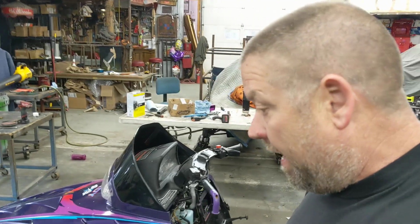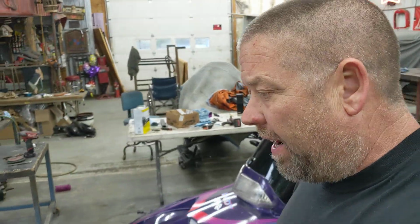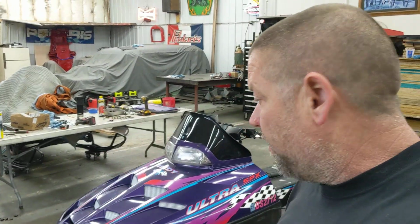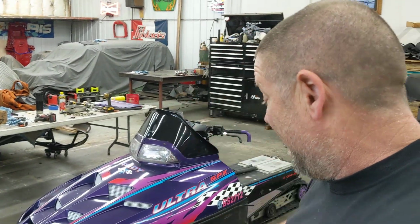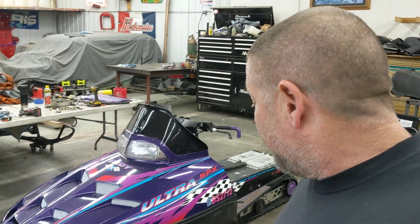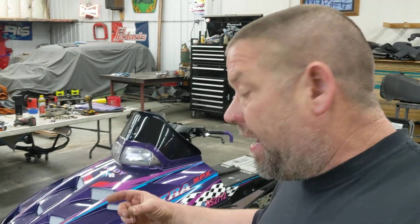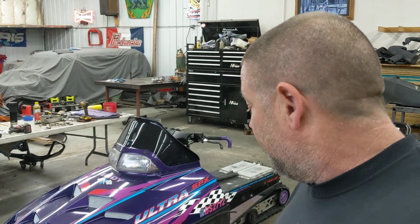Wear rods on, not new ones, reused the old wear rods. I had to build up some weld in front of the carbide because the rod was wearing down enough that the carbide was catching on everything. Just did a good cleanup on the skis. We did put new nuts and stuff and new hardware, and I did my little ski spindle bushing trick.